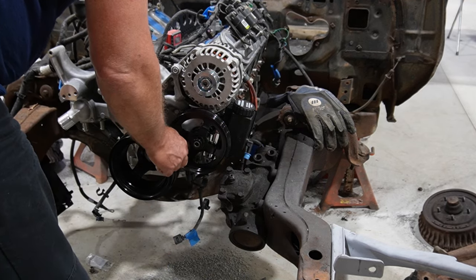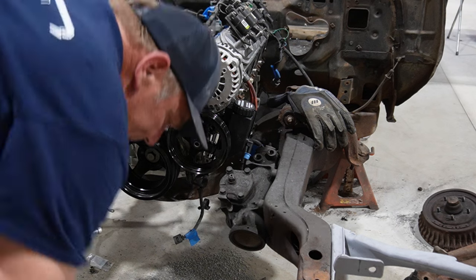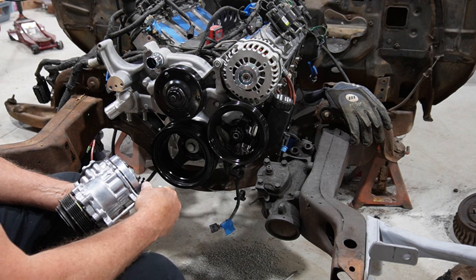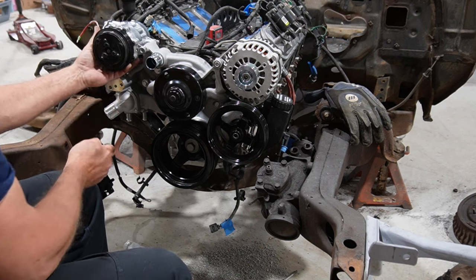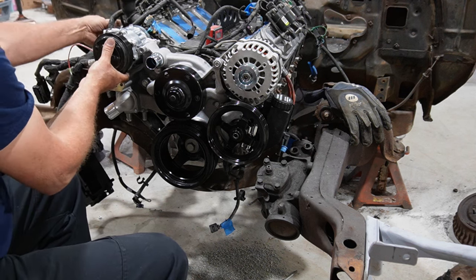And pulley looks semi-aligned. Yeah, close enough for who it's for. Won't kick off any belts or anything, I don't think. So next step is throwing an AC compressor on. That goes in this top slot over here. Let's see here. The one side is slotted, so you want to go ahead and put in one of these bolts first. I mean, let's go that direction. Then you can just slide that into that slot, and then feed the other bolt in the back side. If you're coordinated enough to do it.